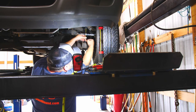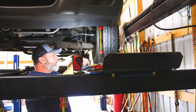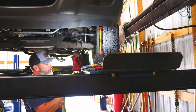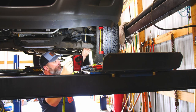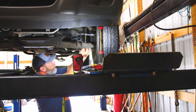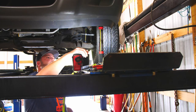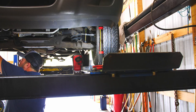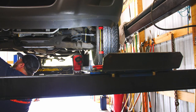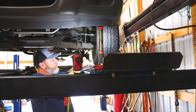Sometimes you have to back up and punt — reposition yourself, and that's okay. Bushing goes up first for the control arm, then washer, spacer, and your nut. Now I'm going to tighten my other side back up and it'll pull the sway bar down and give me the amount of threads that I need.